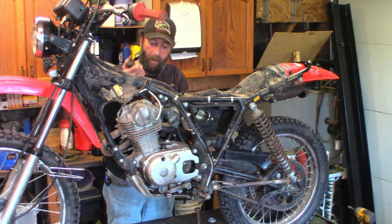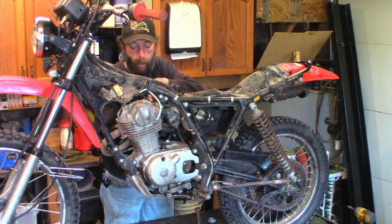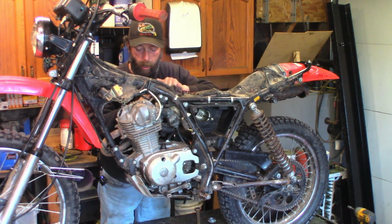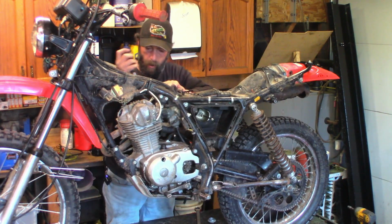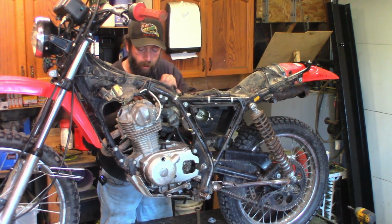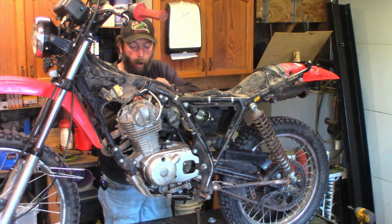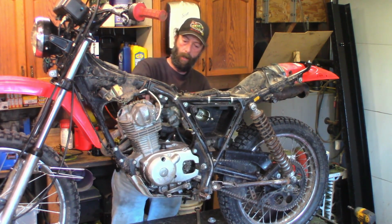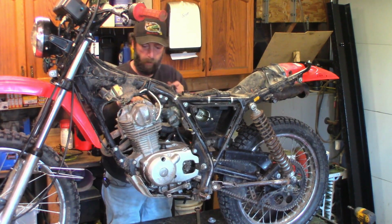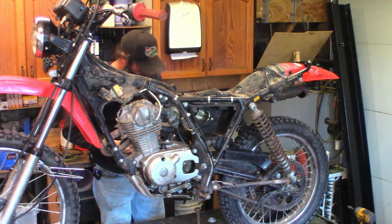Nope, too tight still. Of course, this is the most awkward one to get to. Oh, it does not want to turn. I'm trying to use the lock nut to keep tension on the screw so it can only turn a tiny little bit. Like we're talking tiny, tiny movements here to get this clearance. Oh, that's darn near perfect right there. I dare say that's perfect. Feels the same as the front. Feeler blade just slides in. I think we're golden. Well, it's about time.